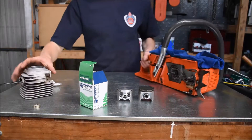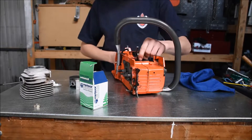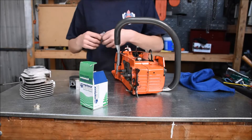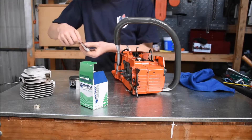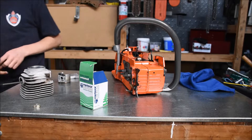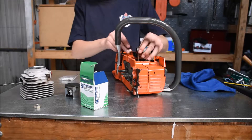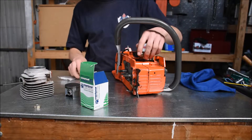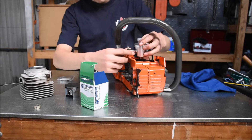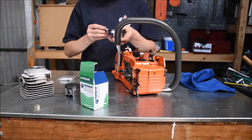So we're going to go ahead and install this new piston. The old one's been removed off the crankcase — I've cleaned that out and lubricated it up a bit. So new piston, new con rod. We're going to have to reuse the bearings off the old one. I've pulled the old needle bearing off the old piston and that slips into the con rod, then the piston goes on and the wrist pin comes in.